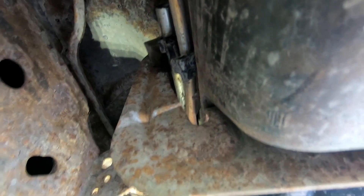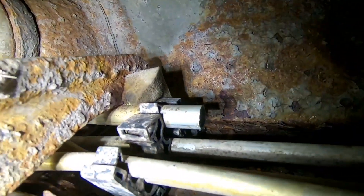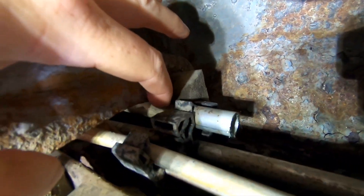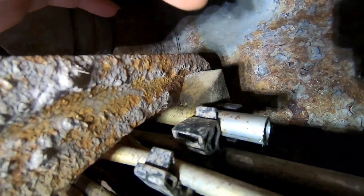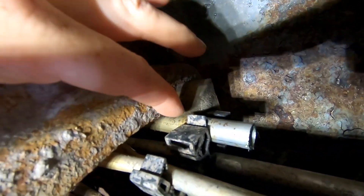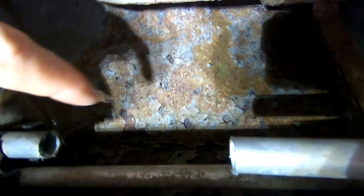That's where we always have our leaks because it's just pressing right up against there. I had already cut out a piece here and I'm going to leave that in — that's actually where it's leaking from right there. They put some foam in here thinking that would help, but it doesn't, because the pressure going in and out just wears it away. This is a low pressure line, by the way, so we're going to run new lines.